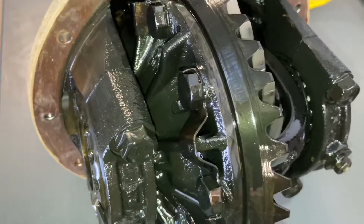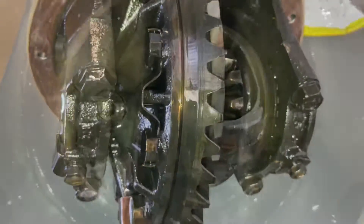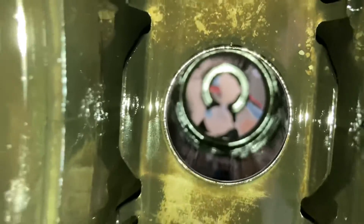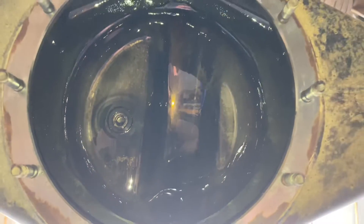If you've got time to make another video, I'll show you replacing the TrueTrack diff center, and we might do another video putting it all back together because you people love it and want to get educated. Help me by pressing like, subscribe, and turn the bell on. Bonus info — see those metal plates on the side there? Be careful when putting the axle back in: you can hit the end of the axle on those edges and knock them out of place. I'm not sure if they're spot welded or just pressure-fitted. When you lift the axle in, you can't just slide it along the base — you need to lift it up and poke it through that hole before it goes into the diff. We'll cover that in the reassembly video.